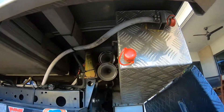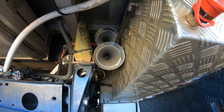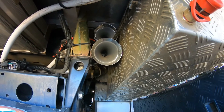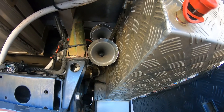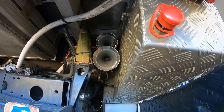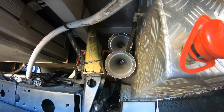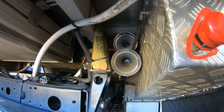The other part of the air system is the air horns, and again I've done a separate video on that. I've mentioned there is a slow leak through a diaphragm on one of those air horns, and it looks like I will have to replace the solenoid — the air solenoid in the horns — just to stop that air leak.